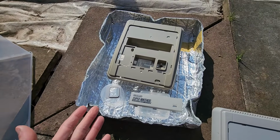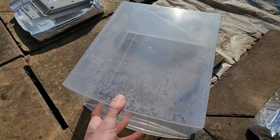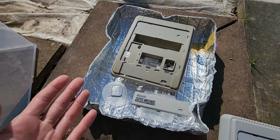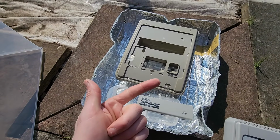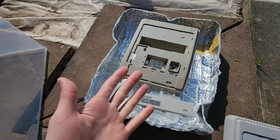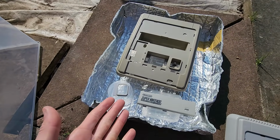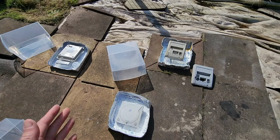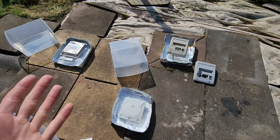So now we're in 5 hours on the second day. The H₂O₂, the hydrogen peroxide, is still reacting. It is still giving off heat. So I think what I'm going to do now, I know it works. I know it takes a lot longer than retrobriting, but how long will it take until this stops reacting? Because we know hydrogen peroxide breaks down in the presence of light and heat. This is why it's stored in brown bottles, or at least not transparent bottles anyway.